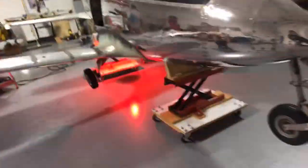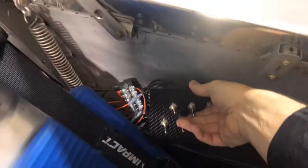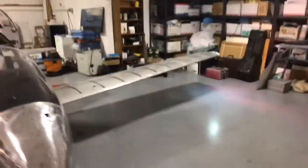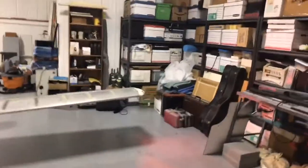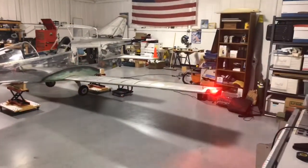I've also done a little work on the wingtip lights — the wigwag function wasn't wanting to work. Say hi, Nico. Now when I switch the lights on I should be able to get a whole bunch of things functioning. There's the underneath beacon, and the aircraft is jacked up right now, but that should provide enough light to warn people that the engine's about to start. Then when I bring the other lights into play, the strobes will change, and we'll switch the landing and wigwags on. You can see this side blinking.